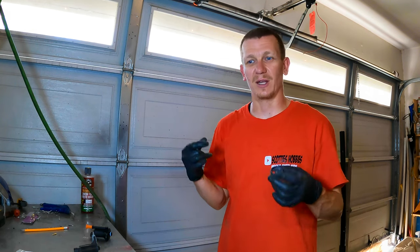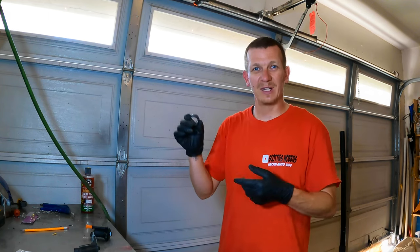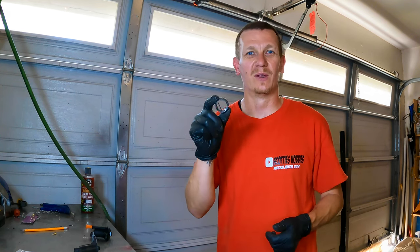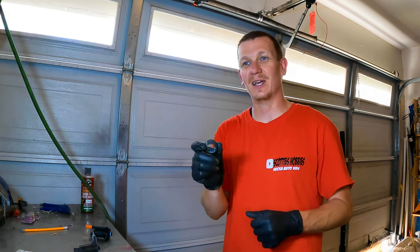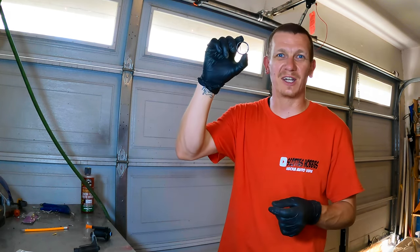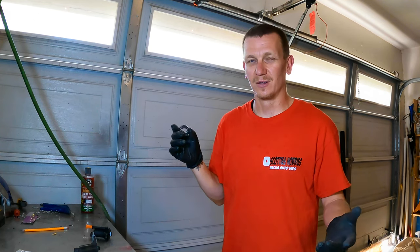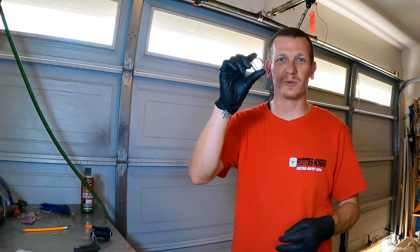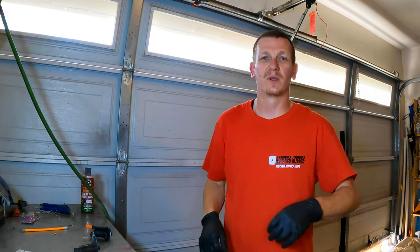I asked him about it and told him to check his cameras. Sure enough, somebody did steal his gas about two weeks ago, which coincidentally was right when the problem started — he came out one morning with no gas. That was the night he got taken. The screen and flapper were inside the filler hose. I fished them out, and obviously it was easy to steal his gas since the flapper was gone and it went straight down to the tank.